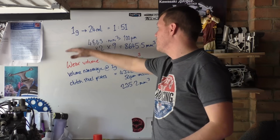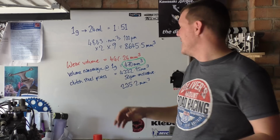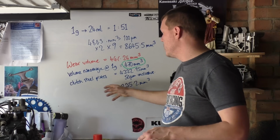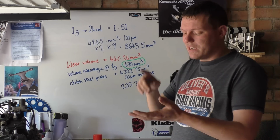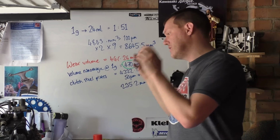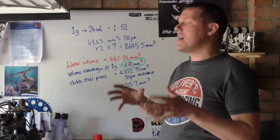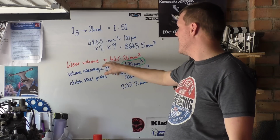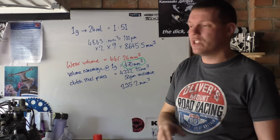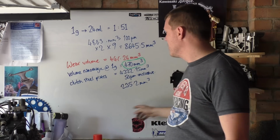I've got the dilutions right, it's higher, it's in their favour. But I also got the cylinder wear wrong. You know, your cylinder's probably out at the service limit. And your clutch probably isn't this worn out. But like I say, we haven't added up all the other things. Like bearings, tappets, valves, valve guides and all the rest of it. We are miles off. You know, just for your clutch steel plates, we're an order of magnitude out, which is 10 times. And that's not including the cylinders. This is not adding all of this up.